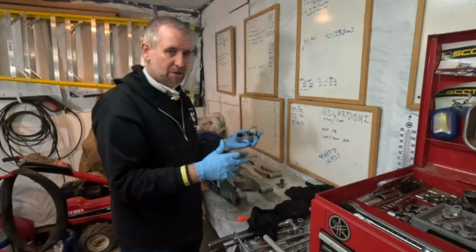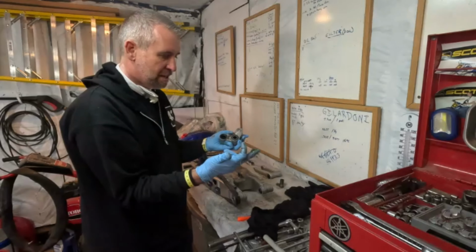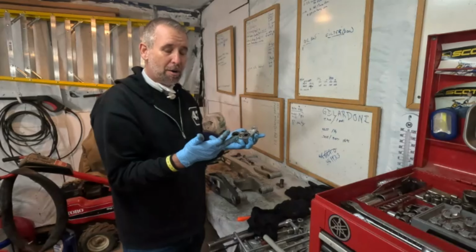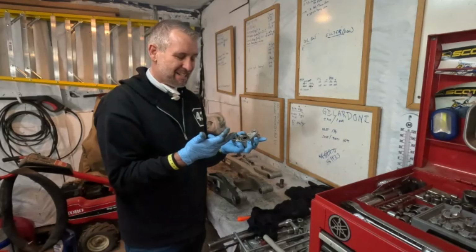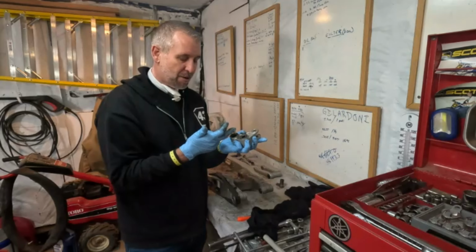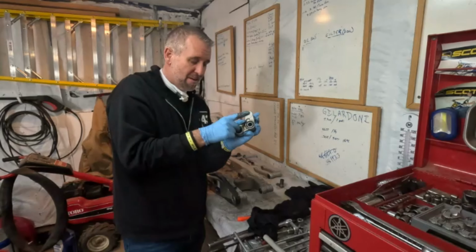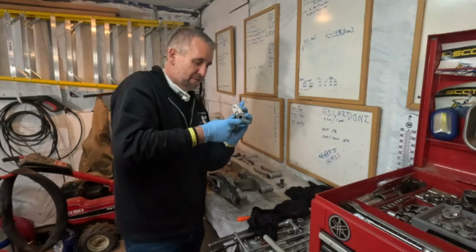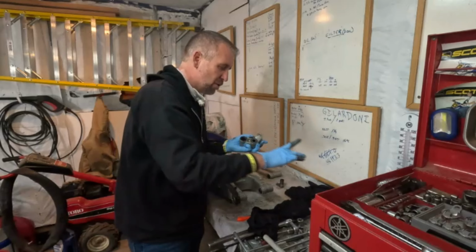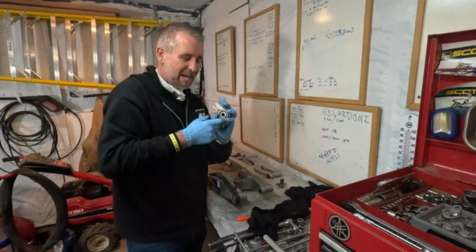Once you've got most of the grud out, get some fresh grease on your finger. We're using Belray waterproof grease, just because that's what I've used since I worked in the bike shop. Just make sure it's a high quality grease that can hold up to the heat. You shove it in, fill it in there. Don't worry about using too much, the extra will come out later on the other side.